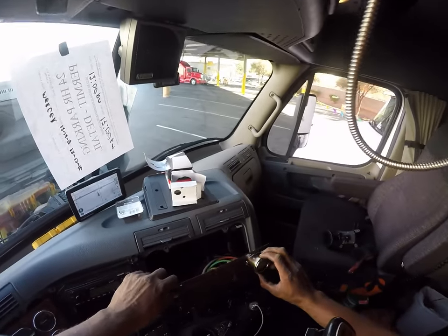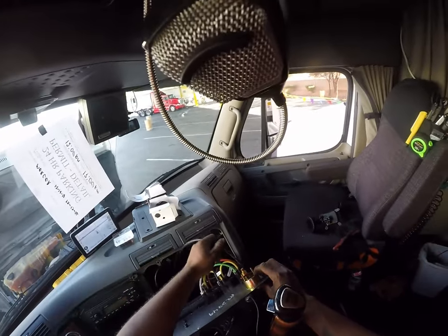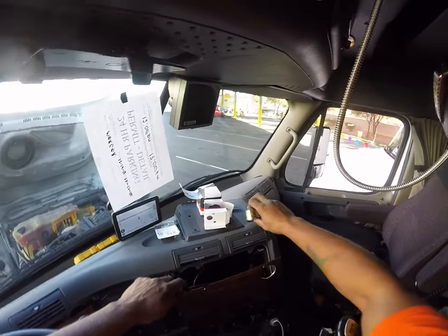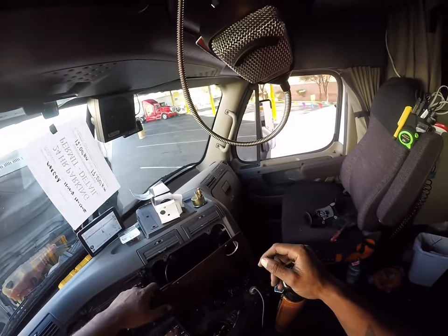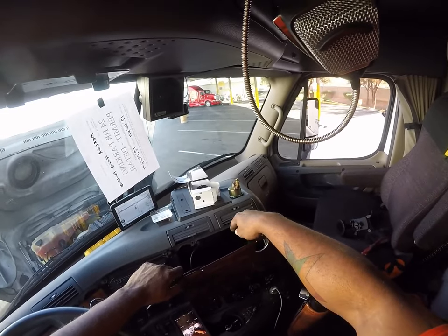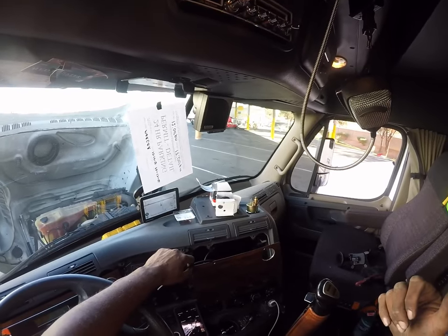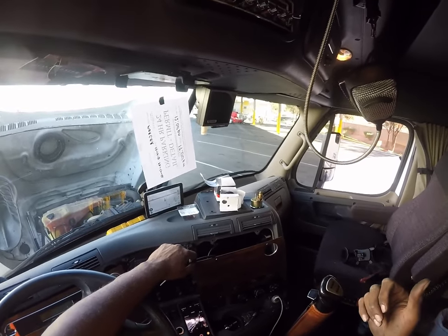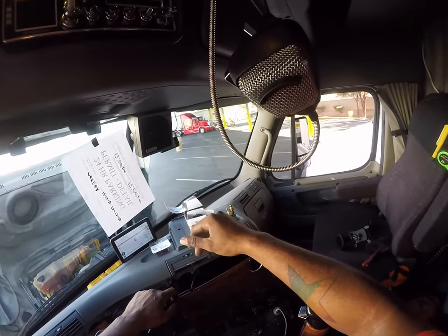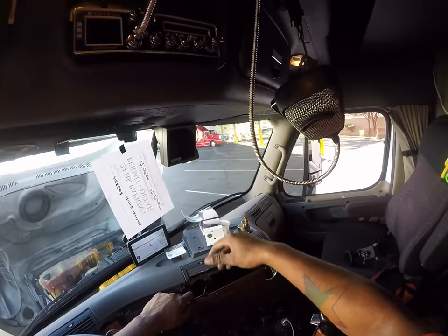So this will just sit in here like so, and then this wire right here, the brass fitting, will connect into right here. All right, so that's pretty simple. So now that we've got that done, we're going to go ahead and do our electrical wiring. Once the electrical wiring is ran to right here, we'll have power for this. Then we'll put our airline on the airbag, put this up right here, and air the system up, making sure we don't have any leaks. If we don't have any leaks, we'll zip tie everything down in place, place our panels back on, and we'll be done.